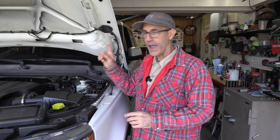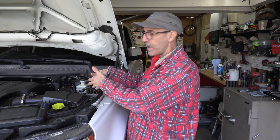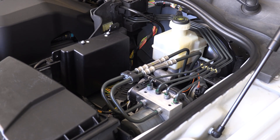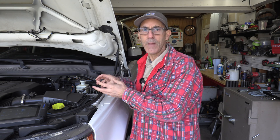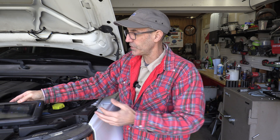That leads me to believe there is still an air bubble in here somewhere. The ABS system is the obvious place where that can get trapped, because as you open your hood and look for your ABS pump and brake system, you'll see there's a lot of hoses going in and out of that thing. That's where an air bubble can get trapped, and it's hard to coax that sucker out of there. That's when you need a tool like this to actually activate that pump while you have one of the bleeder valves open to help nudge that air out.